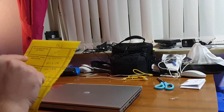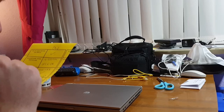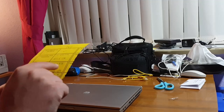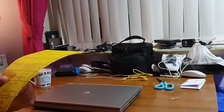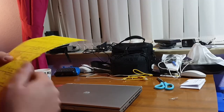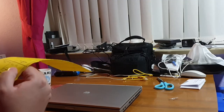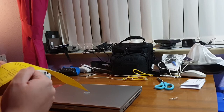Tech, processor model version, speed and cores: i5-3320M at 2.6 GHz, this is dual core hyper threaded. Display condition resolution: 1366 by 768, touchscreen, no, that's okay. Graphics, HDMI, DisplayPort, VGA, DVI. So DisplayPort is circled and it's integrated. RAM quantity and type, 1x4GB, DDR3. Hard drive types, form factor, size, caddies: 500GB, 2.5-inch hard disk drive.